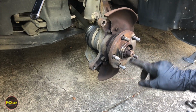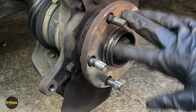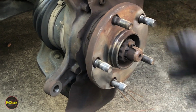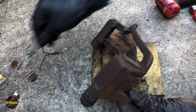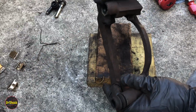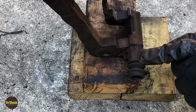All right, guys, we've got this wheel bearing flange all done except for this. I'll show you this last piece and the technique I use for getting this cosmetic surface corrosion off. Then over here on the caliper bracket, right, we've got our 2 pad mounting surfaces. These are our support pads that we were talking about earlier. We got these all cleared off here. I went ahead and popped off the one dust boot here, and I left one of these to show you and one of these to show you.